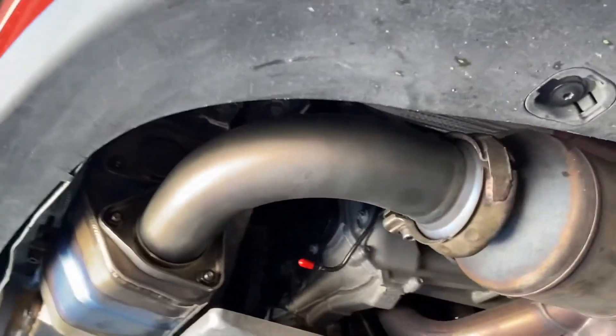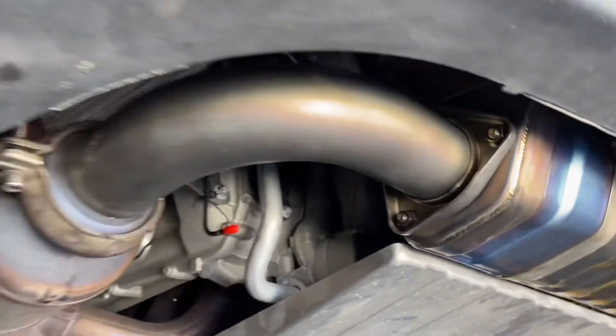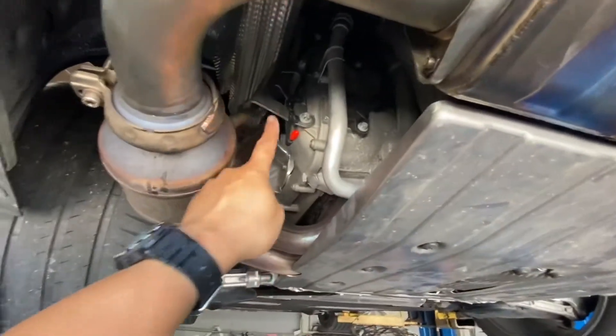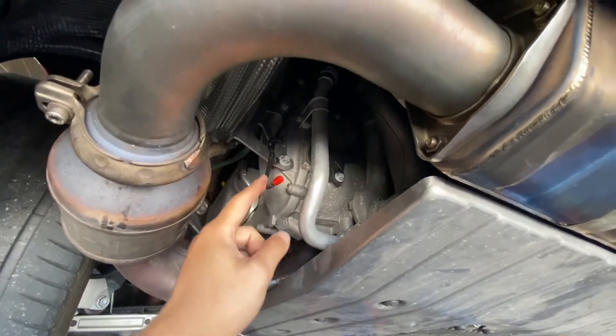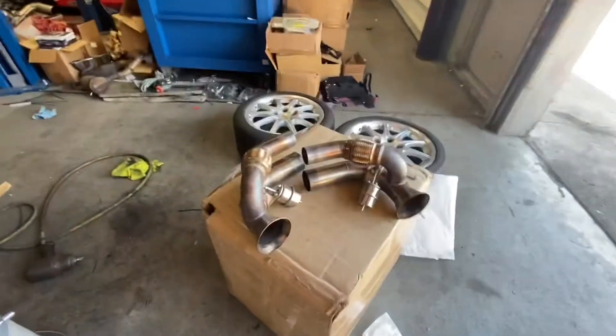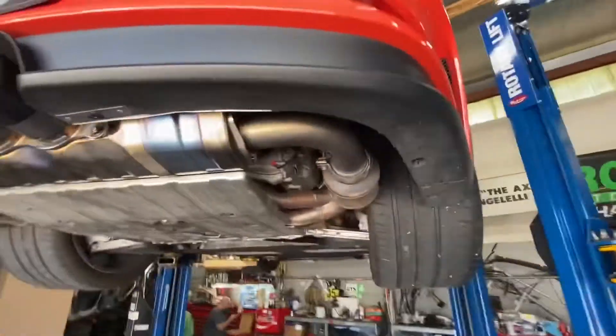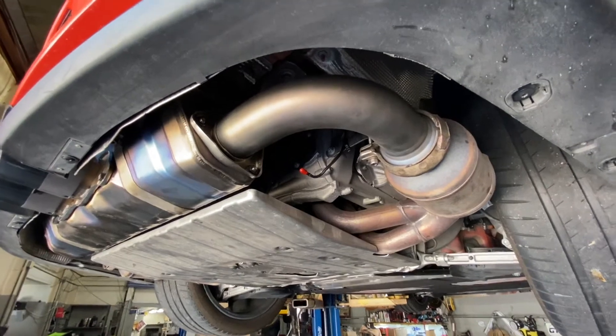The titanium pipes are now installed. It took a bit longer than I thought — I originally estimated 30 minutes but it ended up taking three and a half hours because I had to machine the flanges to fit. Some people take these brackets off when doing side deletes; I prefer to keep them on, as they provide a secure place to tie the vacuum tube to — capped off. You do save about a quarter of a pound by removing them on both sides, but just in case I don't like the sound, I want to be able to go back to the TPC racing pipes with the valves.